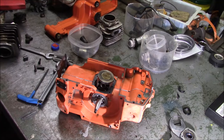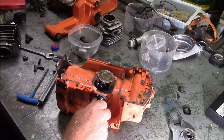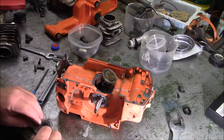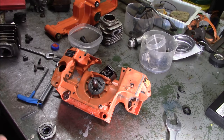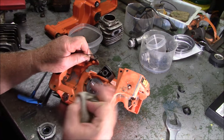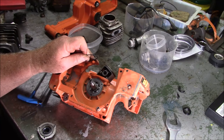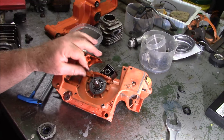These 254s — one of the reasons I like them is they're very, very rugged. They have the same bearings as a 372 with the 6202 bearing, same seals as the flywheel side of a 372. The wrist pin is a 12mm wrist pin like a 372. So really the pieces that count are just about as rugged as a 372. I like the concept of having the larger components. A 372 will run 13.5, and when I'm done with this saw, it will run 13.5 as well.